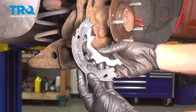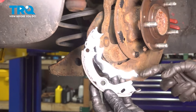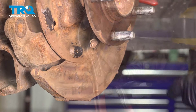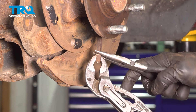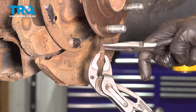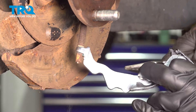When installing, you want to make sure you have the proper parking brake shoe — looking in the kit, we want the armature or actuator for the parking brake on the rearward shoe. We're going to have to put this onto the parking brake cable. To do that, use two pairs of pliers: the first pair goes right along the bottom area, the second up along here. Gently pry against each other while holding on the center, and then slide the parking brake actuator into the proper position. Now it's time for the parking brake shoe — slide it right into the groove and release pressure.